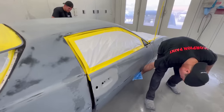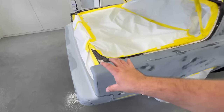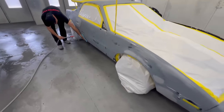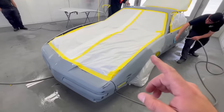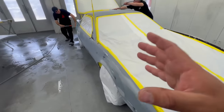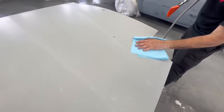This process will be completed on the whole entire vehicle right before you paint. Give it about 10 to 15 minutes after you do this, just so any solvents still lingering within the crevices or on the panel can completely evaporate and dry. As a final prep, the guys are blowing lightly with air and a tack cloth, which will ensure any remaining lint is taken off the panel. This does not guarantee it's going to come out 100% clean, but these are the things you need to do to give yourself a chance at a clean spray job. A tack cloth has a low tack to it — it picks up any dust or lint still on the surface.